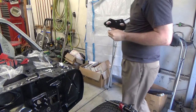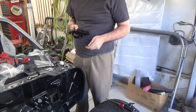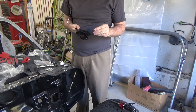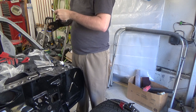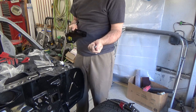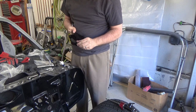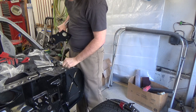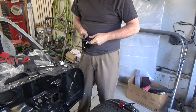A little bit of a pucker moment here — the powder coat got down inside the holes on this thing so the bolts wouldn't go through. I was trying to use my tap and die set to figure out the thread size. Best guess was 5/16ths by 18. I couldn't run the die over it, but it seemed to line up with the taps. So I just took the 5/16ths by 18 tap and ran it through there. That seems to be the ticket, though it doesn't want to go in very easily — it binds up.